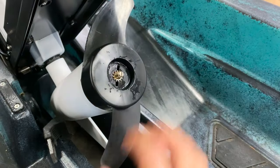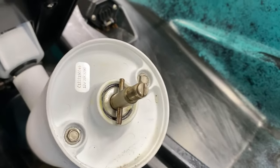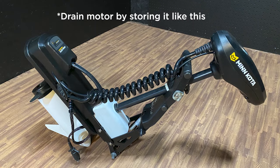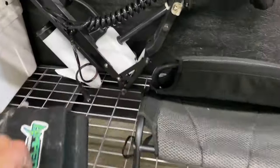For motorized models, store the motor units inside, keeping them dry and ice-free. Inspect the cord and plugs for damage and corrosion, and clean and apply dielectric grease. Clean and inspect the motor unit for damage, and order spare parts such as prop pins and propellers. Drain the steering motor on your autopilot motor of all liquid. Remove all batteries from your kayak, as well as the iPilot remote.